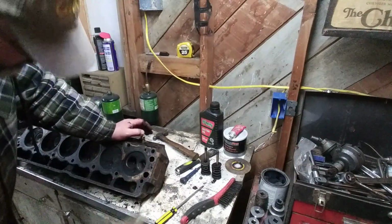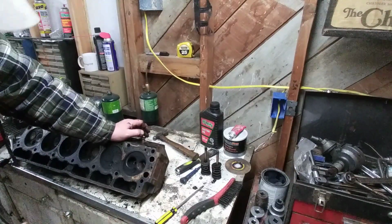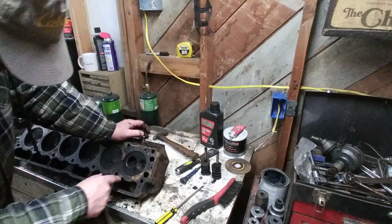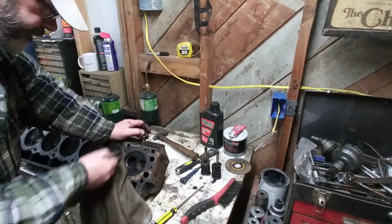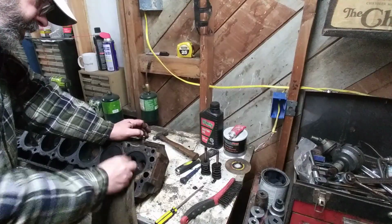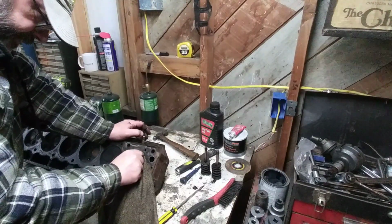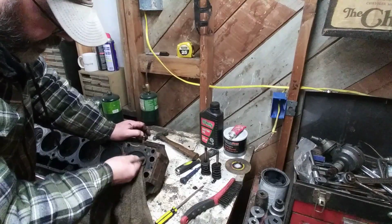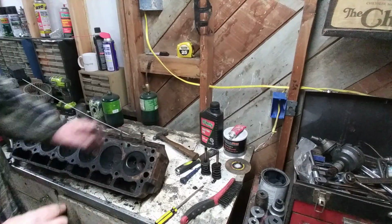But like I said, since you're going to have to grind the valve anyway, replace the valve, you might as well have put new seats in this, because I think they're kind of recessed into the head a little bit. They're not badly pitted. But these heads are, what, 60 years old now? Who knows how many valve jobs these have been done over the years. At least one.